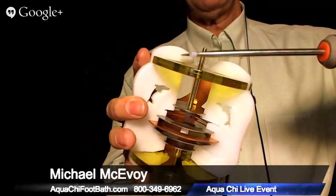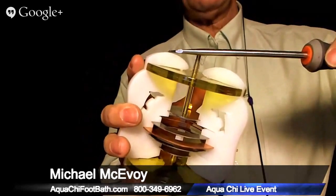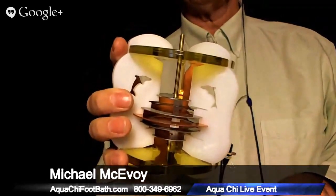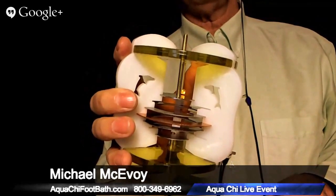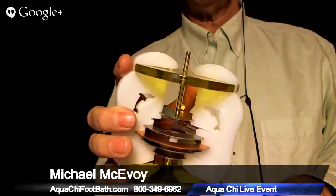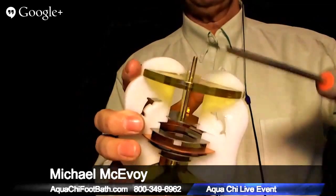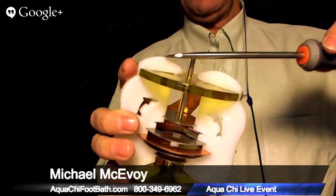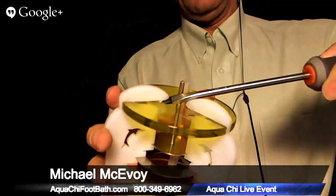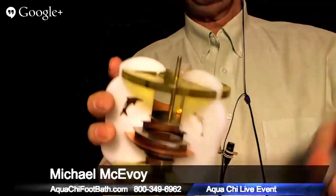In fact, the best thing to do before you start is to put this module in very hot water for 10 minutes. Just get the hottest tap water you can and soak this module for 10 minutes. That's going to give you a little more pliability in that plastic so that you're at less risk of making a mistake and breaking it.